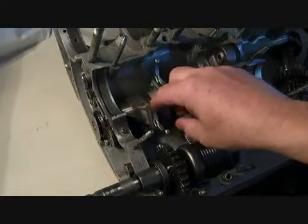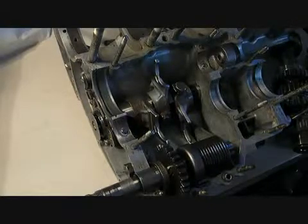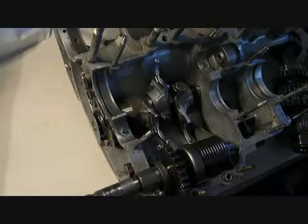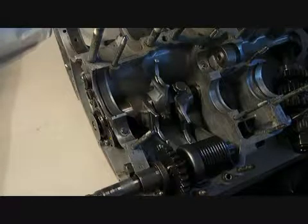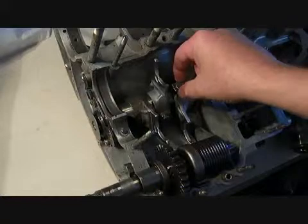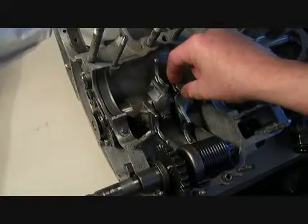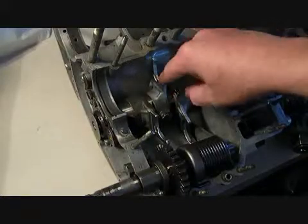A couple of other things: your lockdown tabs for your bolts — I'll reuse them once if they've never been loosened. Most guys would rather just replace them every time, but in this case these look good; there were no cracks, so I reused them. Make sure you bend up both tabs. It's easy to bend, and make sure you bend around the corners so your lock tabs are actually bent all the way down flat.